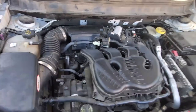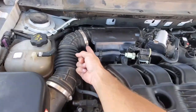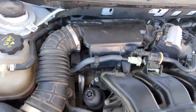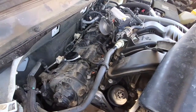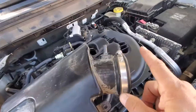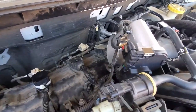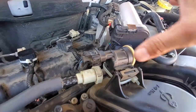The process of taking this off is going to be really simple. There is a flat head here and a flat head here that takes this hose off. There's a flat head back here that'll take this air box off. This air box pops off of a couple of clips in the back and one on the front, and all this stuff comes out of the way. With those two components off, we're right into where the throttle body is — it doesn't take much to get back to it. Two screws on the hose, one screw on this, there's also a clip that connects onto here — I believe it's for your baro sensor — it just clips off and comes away. Then there are four bolts on the throttle body, a clip, and one wire connection, and then this guy comes right off.